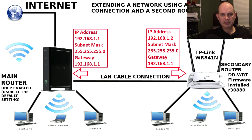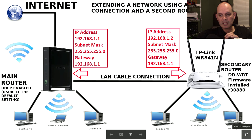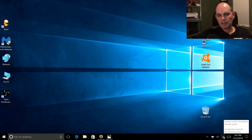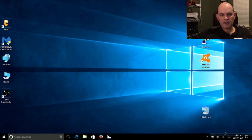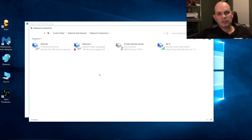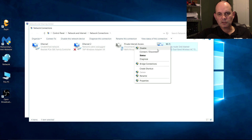Now that the secondary router is plugged into our laptop, we need to configure the network adapter on that PC so it can talk to it. Go down to your network icon in the taskbar, right-click it, and choose 'Open Network and Sharing Center.' Then click 'Change Adapter Settings.' You'll see all your adapters — a Wi-Fi adapter, an Ethernet adapter, and others. If you have Wi-Fi, right-click it and choose 'Disable,' because you don't want to be connected to any other router than the one you're configuring. Once disabled, identify the Ethernet adapter that's connected — you'll see one with a red X and one with a cable icon. The cable one is the connected adapter.